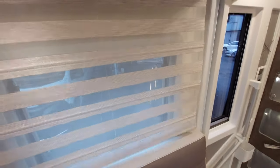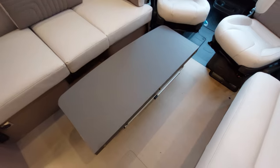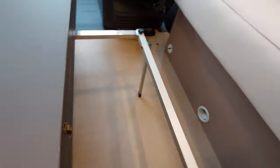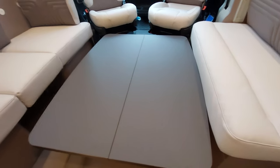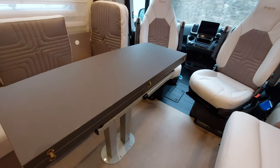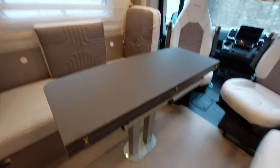The two windows at the front have variable blinds — just pull the cord to lift the blinds up and set them at whatever height you want, the same on both sides. The table will lock down. For those who've ordered the dinette-to-berth option, spin the legs down to give support, flip the table over, and your two infill cushions go in the middle — note this does not come as standard. The table itself pulls up; to get it to come down, you've got to lift the table up first, then push it down, and it will stay down. You'll need it down if you want the bed to come all the way to the lower position.